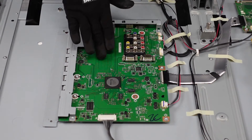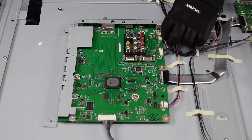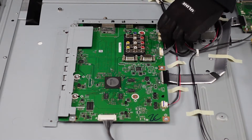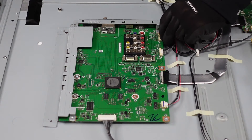The first board we're going to be removing is the main board. It does look like there are some clips along the side as well as one along the top that we're going to get out first. These two guys down here — we're going to push down and depress the clip on the top, which then unlatches it. They come right away from the board, no problem at all.